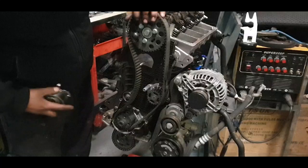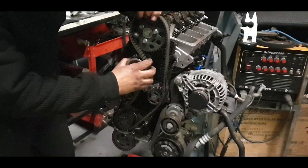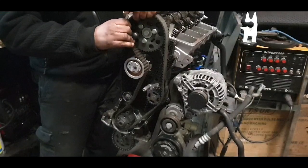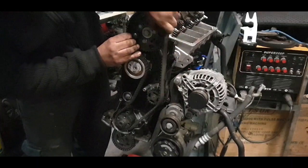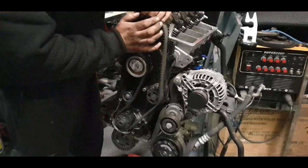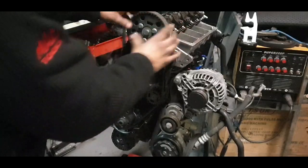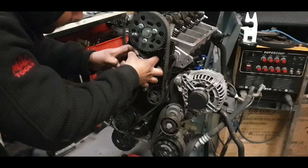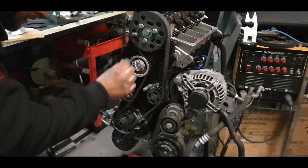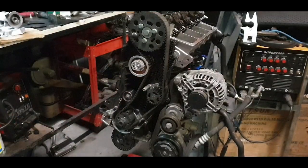On this engine, always put the belt in — just take a little bit off on this side here when trying to put the tensioner. The belt needs to be off up here otherwise you can't fit the belt because this belt is really really hard, so sometimes you have to just slide it off a bit to make it easier. Now you have to make sure the tensioner fits on the small hole on the back — it has an arrow thing that needs to go inside to make sure the tensioner fits on there.